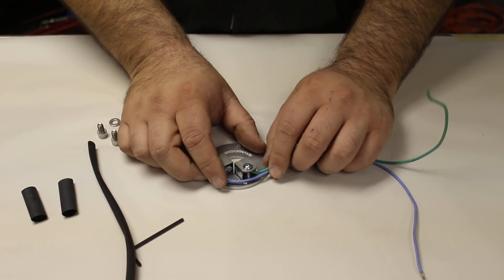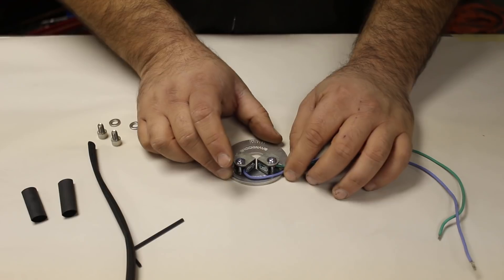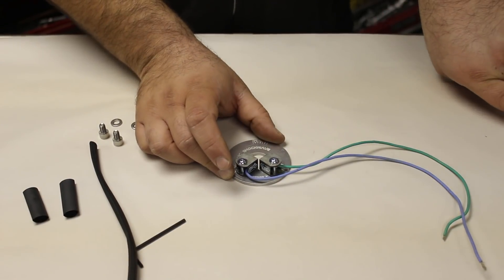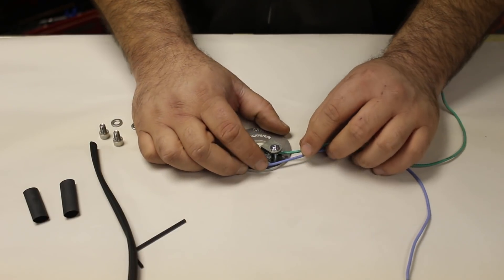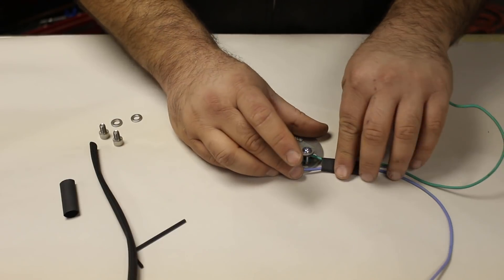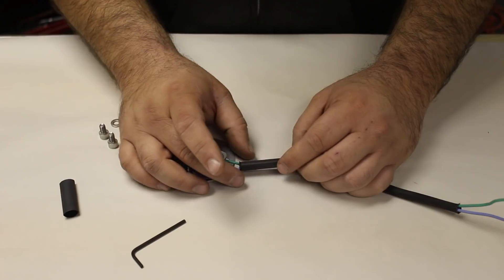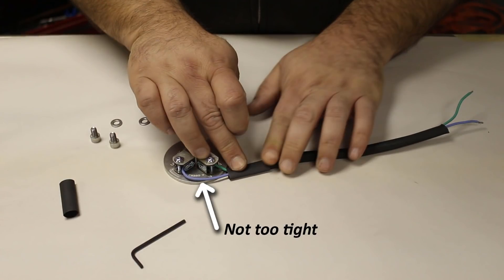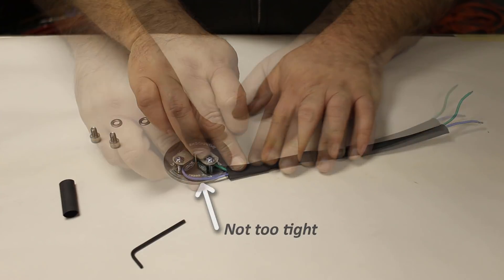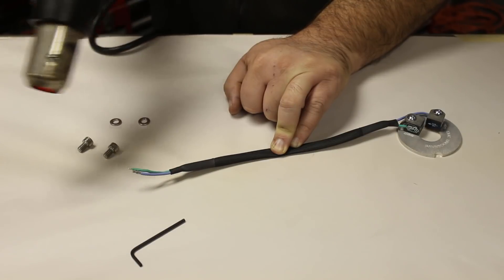The wires are positioned to exit the points chamber as if they are on the bike. For the CB350 and CB360 families of bikes, the wires exit to the right side of the chamber. For the CB450 families of bikes, the wires wrap around the bottom of the sensor plate and exit out the back side of the points chamber. If you are unsure about the exit wire routing, refer to the original wires that connected the points to the ignition coils. Take the small piece of heat shrink and cut that in half. Slide one piece over the sensor wires close to the sensors and then slide the piece of woven thermal sleeve over the sensor wires as well. Tuck the thermal sleeve halfway inside the heat shrink and heat it to secure it in place. Be careful when positioning the heat shrink on the wires — the arrow shows how the wire exits the back of the sensor and smoothly curves into the heat shrink. Leave enough slack in the wires so they are not being pulled sharply from the rear of each sensor. It is best to err on the looser side. Place the remaining piece of heat shrink on the other end of the thermal sleeve and shrink that in place as well.